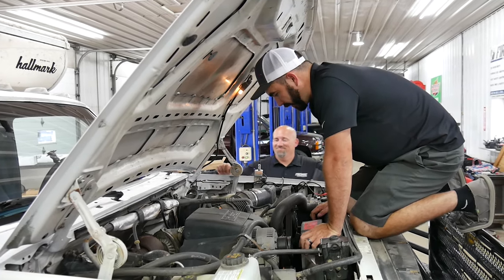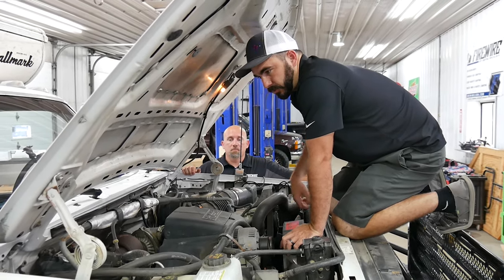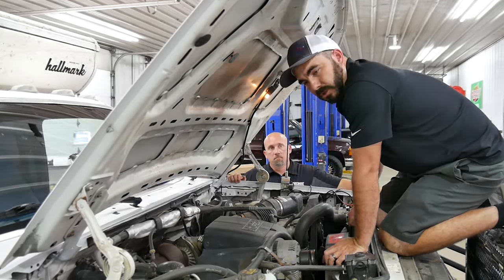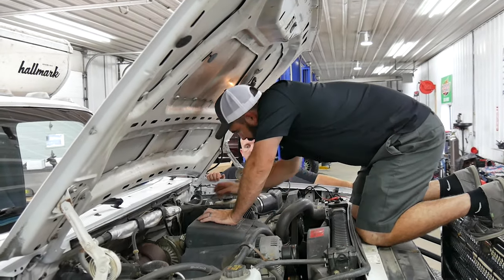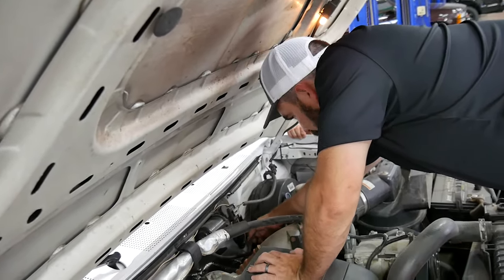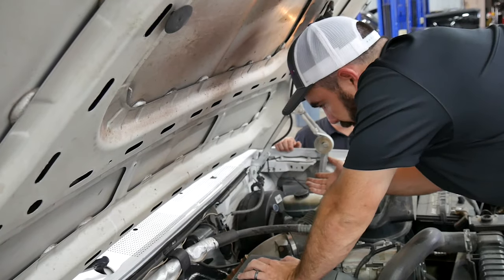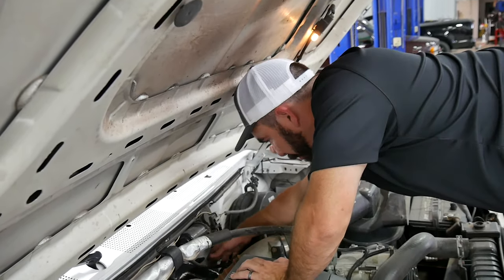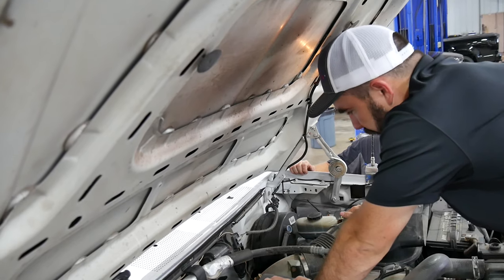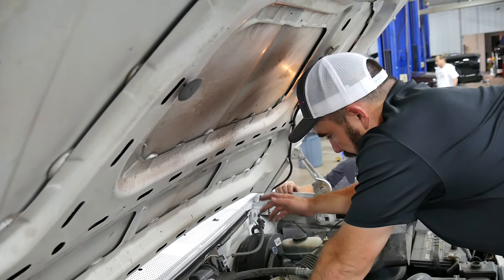Having two people makes a two-hour job a 15-minute job. On this particular truck somebody has already run wires, so there's a hole in the boot on the steering column — that's usually a pretty good place. If you've got an automatic truck, there's a cover plate where the cab is preformed for five-speed trucks; a lot of people take that off, drill a hole, put a rubber grommet in it. If you've got a manual truck, there's a rubber grommet in the firewall you can pop out and go through. For simplicity here, we're just going to reuse the existing hole in the rubber boot.